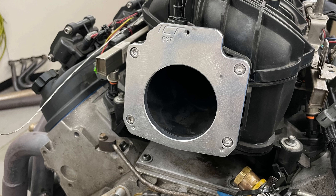A lot of guys wonder how much power the stock throttle body will support. It'll support a lot — if you're blowing through a turbo on a stock throttle body, you could make more than 1,000 horsepower easily because then it's not a restriction. But when you're drawing through it on a big motor making lots of power, it's a little bit restrictive. Put it in front of a big positive displacement blower and it would reduce power even more. We're looking at six or seven horsepower and four to six foot-pounds of torque difference, most of it at the top end of the RPM range.